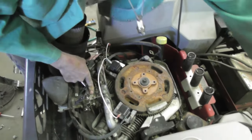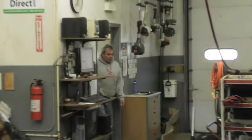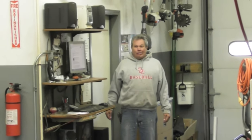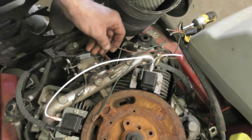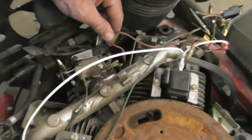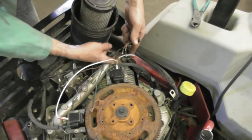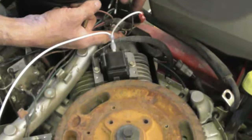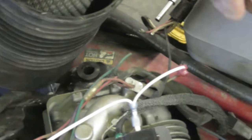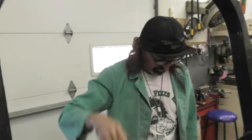I'm going to turn the key and listen for that solenoid. Someone's here going to spend some money - it's Frank. Hey Frank. Frank's gone and he didn't spend any money, he just came in to waste my time. Okay, this power wire is on a separate circuit because you'll hear that solenoid click on and off when I turn the key to the first position - hear it. So that's on a separate circuit, we can keep this disconnected. Now there's a ground wire on this harness hooked to this manifold bolt. The instructions tell you to take that bolt out, but I ain't gonna do all that, just cut it - it's just a ground wire, ain't going to hurt nothing. I'm throwing it away.